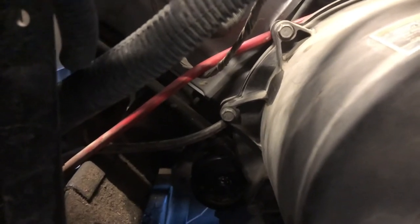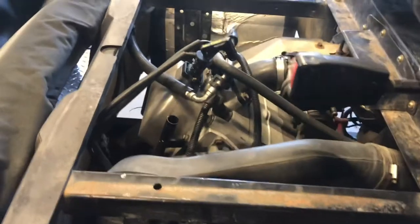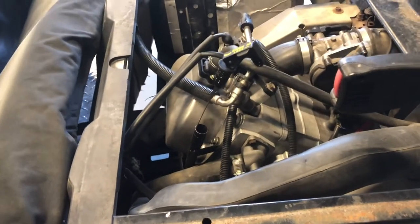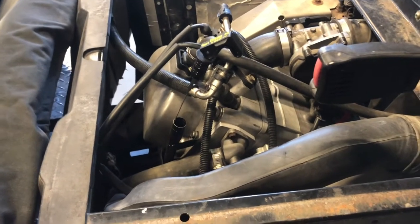You've got your engine oil filter back there and you can go ahead and pull that and replace that at the same time. While your engine oil is draining, you want to make sure that you check that O-ring — make sure that O-ring is off of the engine on your old one, then make sure your new one has that O-ring. That way it seals properly.